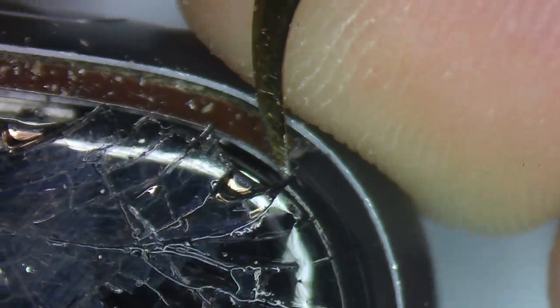Both the top and the right side of this watch were fairly shattered, whereas as we started to get closer to the bottom and the other side, we need to get in there with a piece of plastic and carefully and slowly slide along the top of the gasket without damaging the display to separate the rest of the screen from the frame. And then the screen will come off.